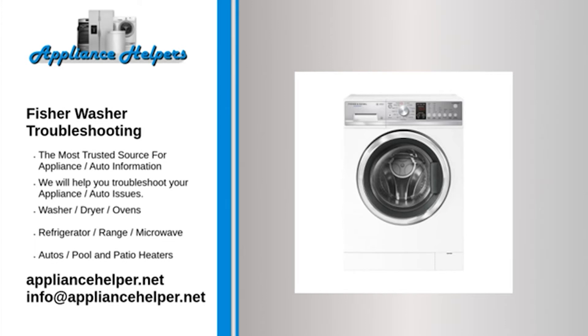The washing machine stops working mid-cycle: Check for an error code on the front panel. Check that there has not been a power failure; if so, restart the cycle once power is restored. Check that the cycle has not been paused — if so, the Start/Pause button will be flashing; press it again to restart. A buildup of detergent suds can cause this problem — check that you are using a front-loader-specific detergent. The wash cycle will restart when the suds have dissolved.